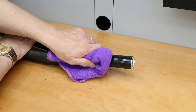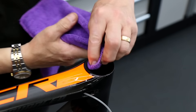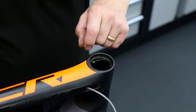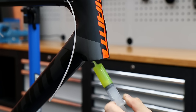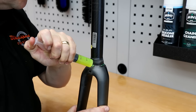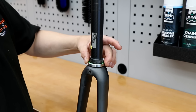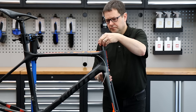I'm going to clean the steerer tube itself and clean out the bearing cups, making sure all the grit and old grease residue is out of there so it's as fresh as the day it left the factory. Now I'm going to put a little bit of grease in the cups. These bearings drop into those cups — they're not a compression or press fit; they have a fitting at the top that puts the pre-tension onto the bearing, which does mean you can get the slightest amount of movement as everything is seating together. The grease will help everything seat into position and stop any creaking or groaning noises.